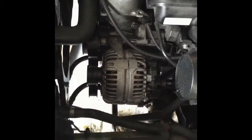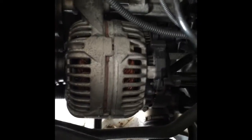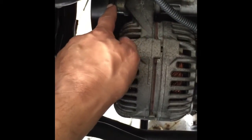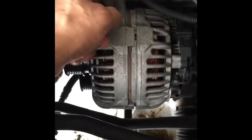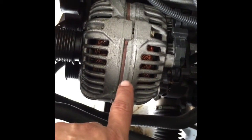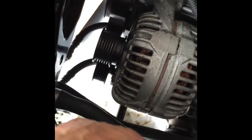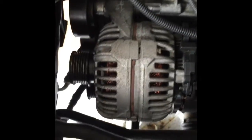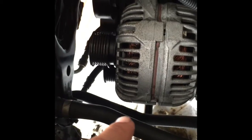The alternator is back on. A few tips when installing the alternator: don't put the pulley in first — instead, take the screw and put the screw in to support the top first to align it, so when you put the bottom screw in it aligns perfectly. It took me a little while but that's probably the best way so you don't have to remove the pulley and all that other stuff. Tighten up the bottom and top bolt to the same torque as the other ones.